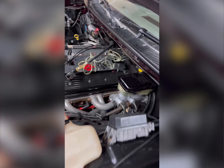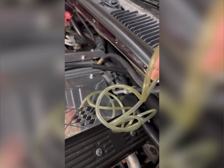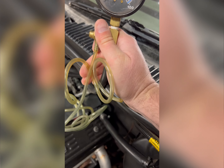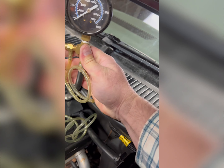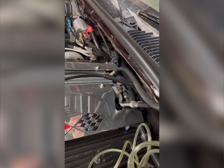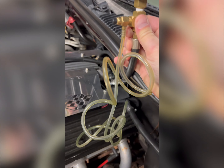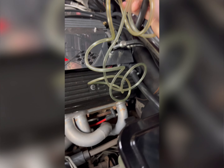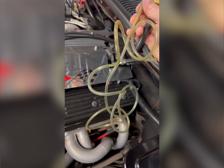Once you get your gauge snug down there - just twist on, make sure it's on there very taut. Set it up where you can read it. When we go to crank the car, I'm going to turn it so I can see what it's doing. Make sure it's tight so it's not leaking. When you go to release the pressure you push this side and it pumps all the fuel into the catch tube - you want to catch it and not let it drop on your headers.